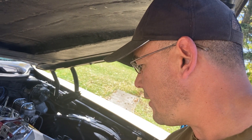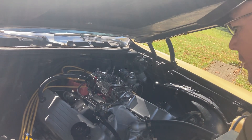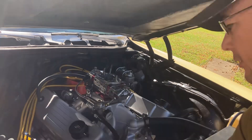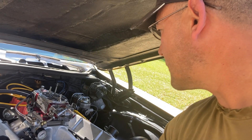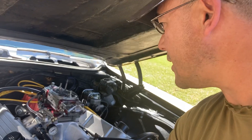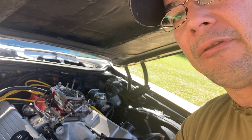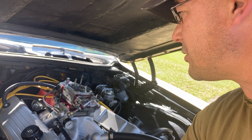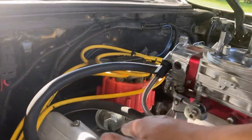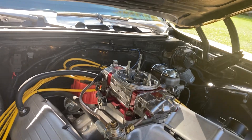That's how I've run all my cars, my street combinations. And with this camshaft, it's a fairly big, aggressive cam — we're just under 700 lift. It's a solid roller. So when there's no load on it, I take advantage of the extra few degrees of free timing added at idle by the vacuum pot. It is adjustable too — there is an Allen set screw inside on this particular one, so you can tailor it to your specific requirements.